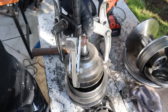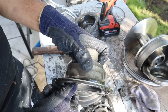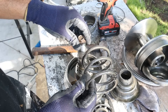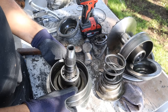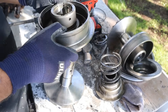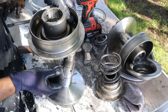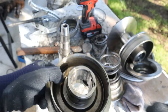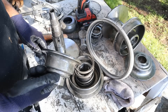That's the piston and it's got a seal around there — the seal looks intact, no nicks like the other one. Here we have this giant spring that provides the preload when the transmission has no pressure. These little balls are what sit inside of these grooves and allow this to maintain its clocking so the torque can be transmitted properly. Unlike the other side, the grooves inside of the variator housing and on the shaft look pretty much brand new — there's no visible wear.